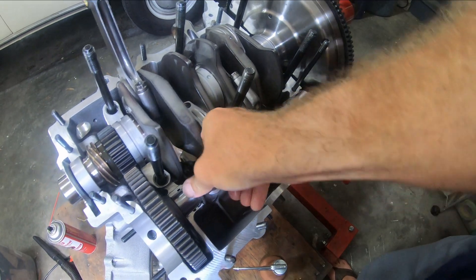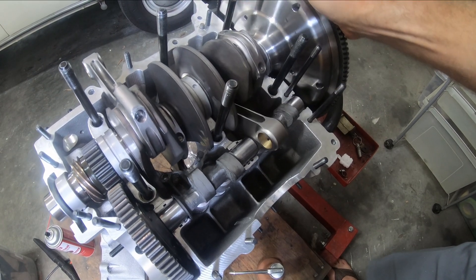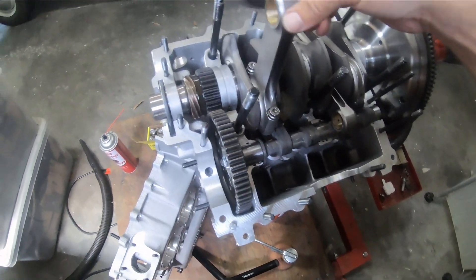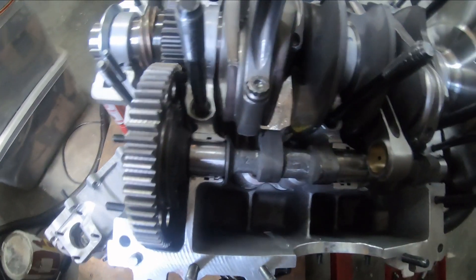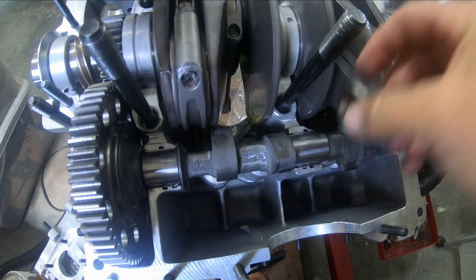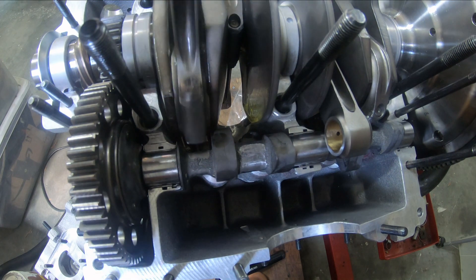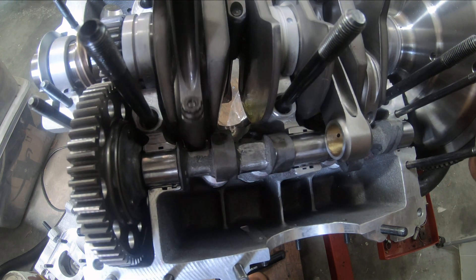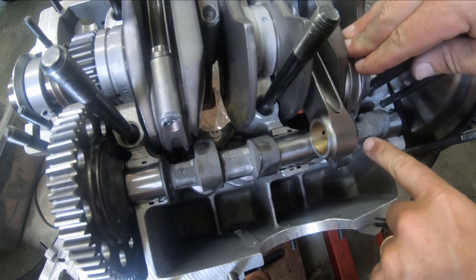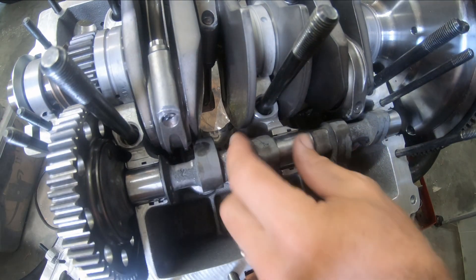I clearanced this here and there, then check the other two which are right here and here — you see this one, right here. Make sure that the cam is all the way down in its bearing, and this one comes down — seems to clear that one just fine. This one here has plenty of space on that pass, so it actually passes both sides.